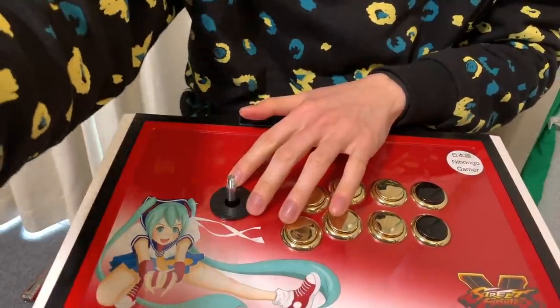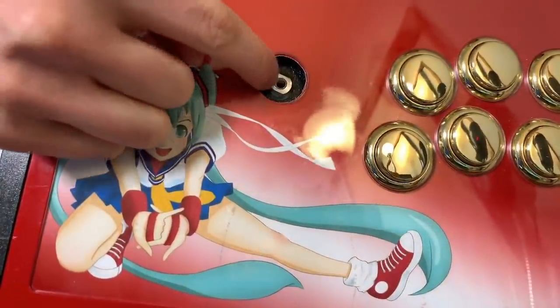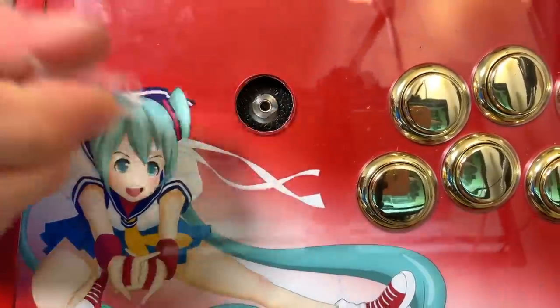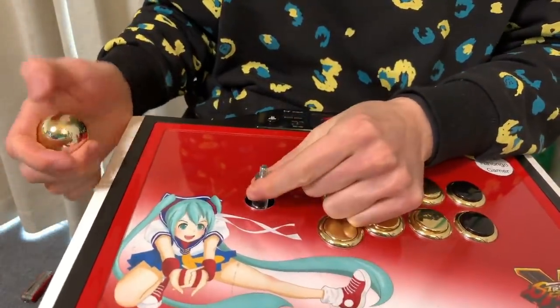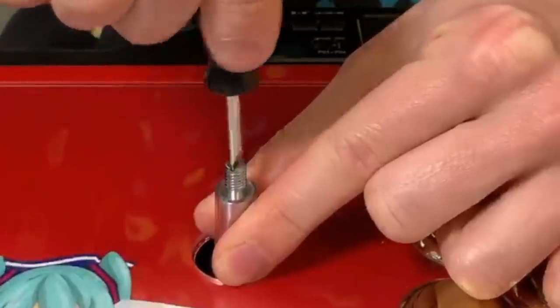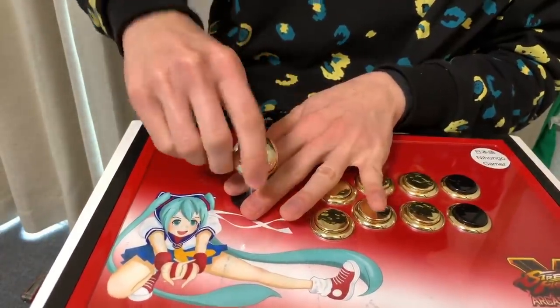Just going to close that up now and we're done. The last thing we need to do is put this protective sleeve over here so too much dust doesn't get inside. We can also slide this on here. This is actually really important — there's a part here on the bottom and top where it goes flat, and that lines up with this shape here. It's round on the sides but rectangular, flat-edged on the top and bottom. That nut is going to be how it tightens, but we don't want it to spin when we're spinning this into it. So we plug this in, hold it in place to prevent it from rotating, and then attach the ball top on like this. You can use a screwdriver — jab it into that hole there, hold tight with your left hand and spin with your right hand. Put the sleeve back on. Hey presto!